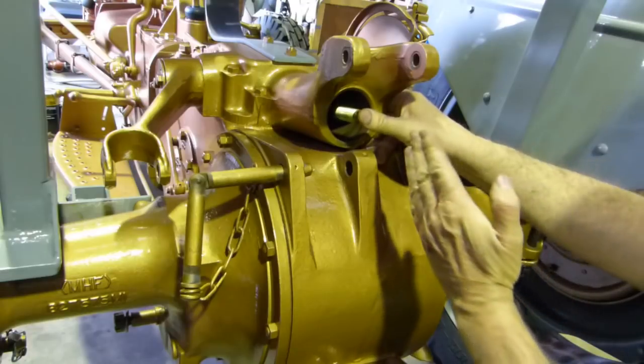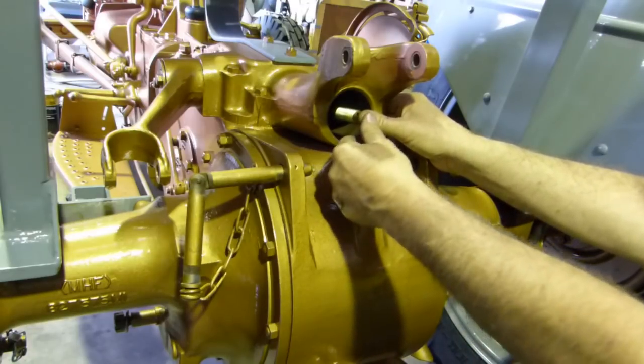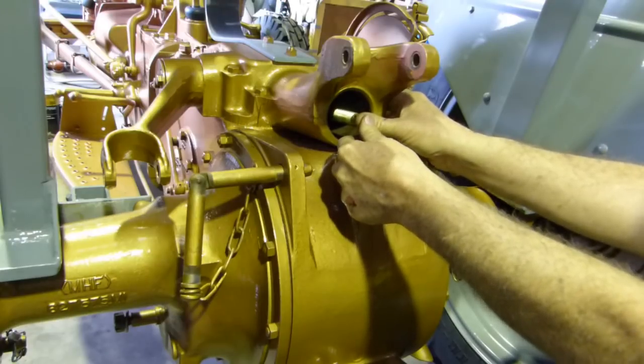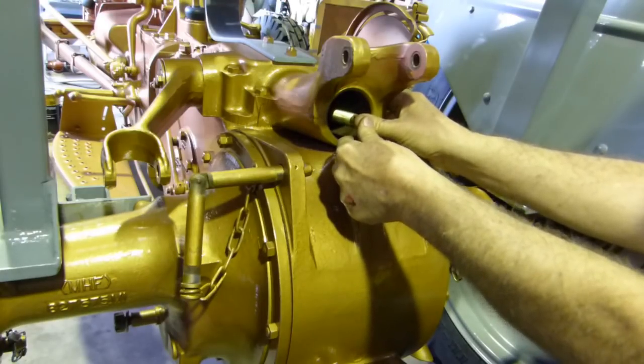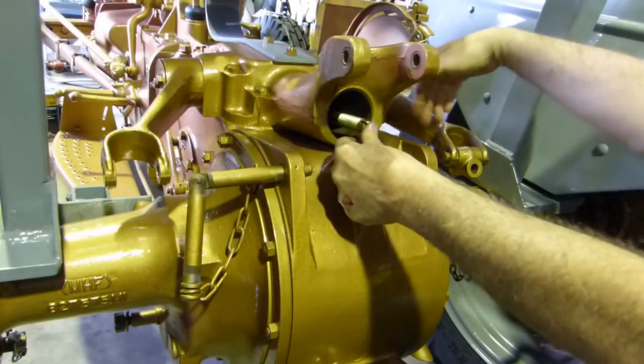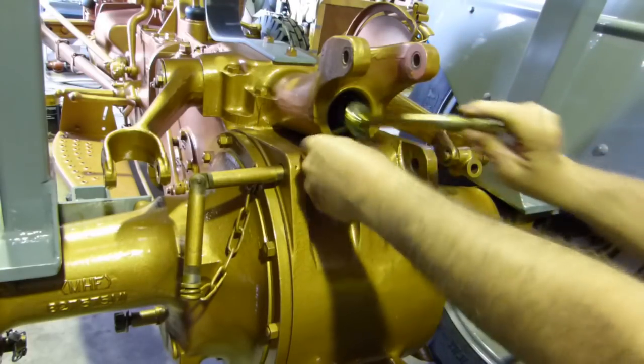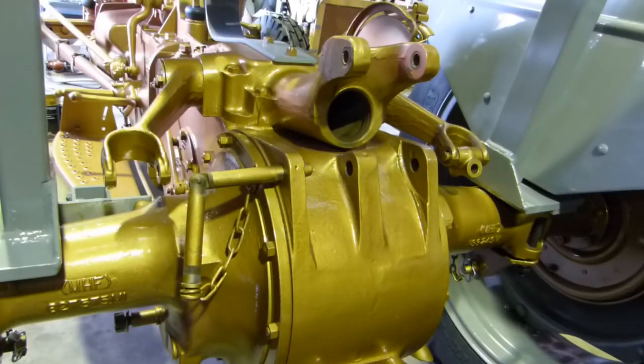So once the load from your plough pushes forward on there, that pushes there, and that's springing there. That's a lever down on the control valve, and there's another spring up in the top. So anyway, not that we're going to worry too much about that, I just thought I'd show it to you.